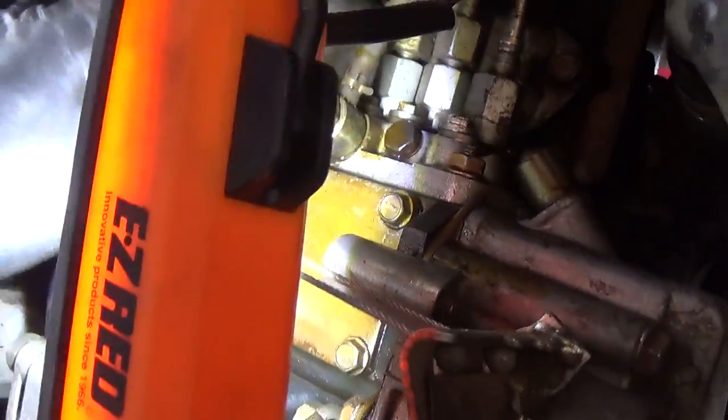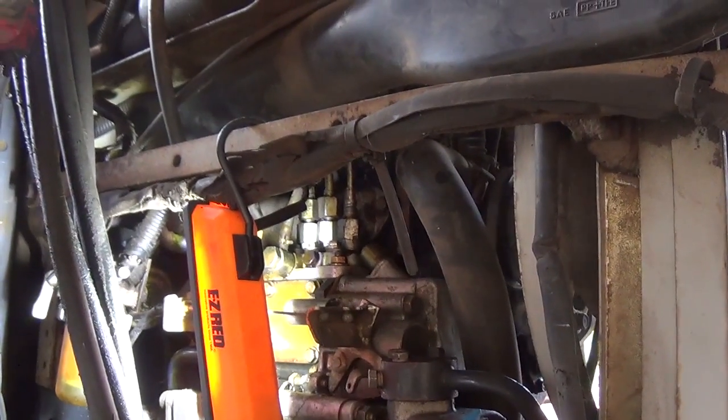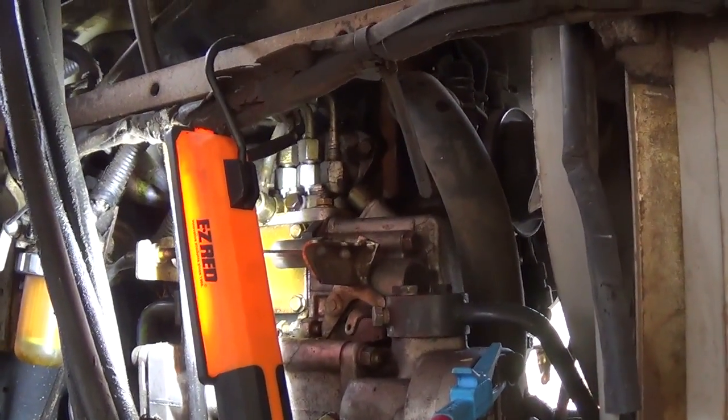I just thought of something. That engine shut-off coil on the pump — maybe that's supposed to be on when the key is on. We're definitely getting power to those two wires, but what if that coil itself isn't doing its thing and the pressure just isn't building? I think that might be our issue. So I plugged it back in, and we're going to crank it one more time to see if pressure builds. If it doesn't, we'll go after that coil.